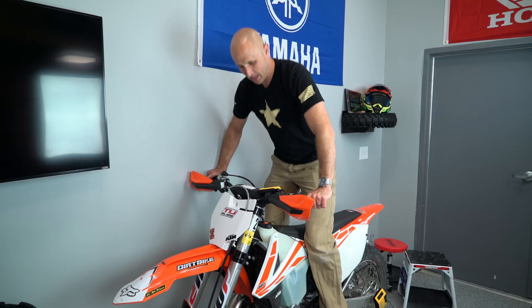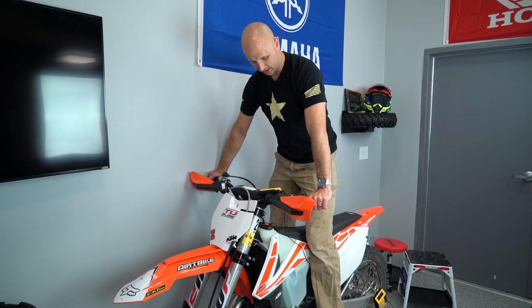So a lot of times what I'll do is I'll look at my sag, what it's like when I'm up in my attack position, let the bike settle under the suspension like this, take a look, okay, here's what it is. I'll sit down in a forward position or in a natural position, see what it is there, and then I'll want to get kind of an average of the two.